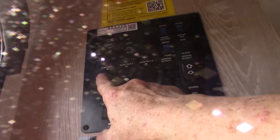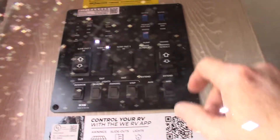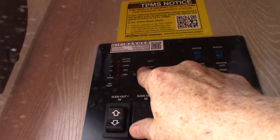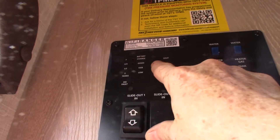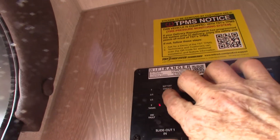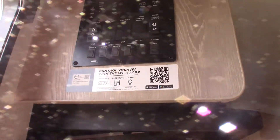This is your slide-out right here. Your power awning is right here — make sure you never leave the awning out unattended; always roll it in when you're not at the campground. You can check your levels here: battery charge, fresh water — it's full. Black is empty, gray is empty. As it graduates up in one-third increments it'll light up. Once it gets past two-thirds, you've got to start thinking about dumping the black and gray tanks.